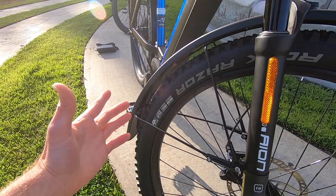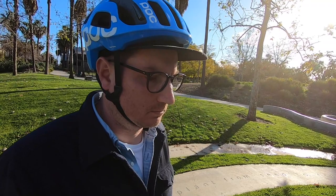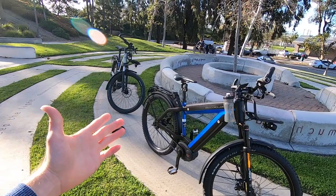Tubeless Easy, so you could run tubeless, although I've heard with high-speed electric bikes, sometimes you don't want to lower the pressure too much. It's technically more dangerous, because if you were to burp the tire going really fast and you hit a bump, the tire can lose all its pressure a little faster than a tire with a tube. But the puncture protection makes a ton of sense for me, like if you're maybe doing trekking or touring with this bike.